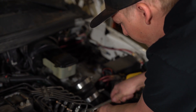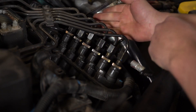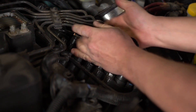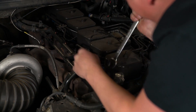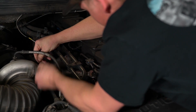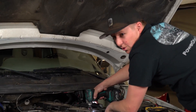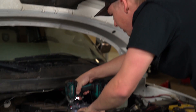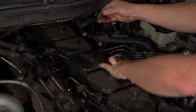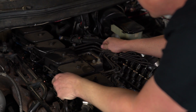There is going to be a little fuel come out of them because obviously we have fuel sitting in there. There are also two more bolts down on the intake holding down your injector lines. Now that we've got them all loosened up, it should just pop right off.